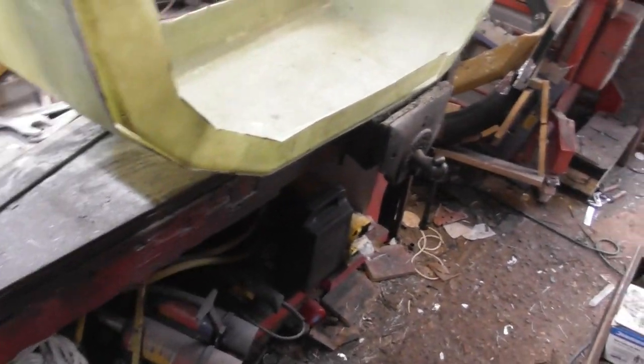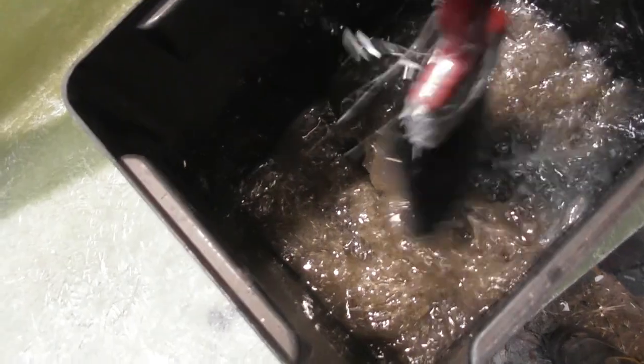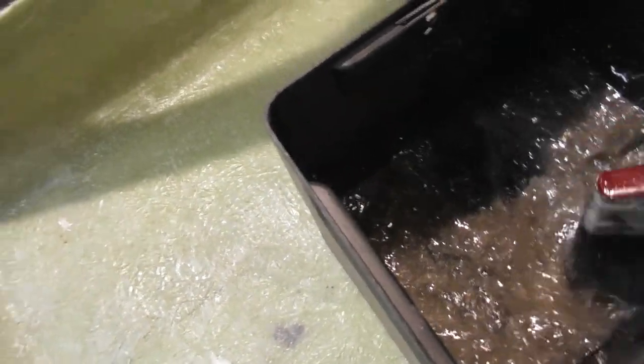Yeah, anyway, I've got to fill it and I've got to clamp it. Resin with a load of that. There was literally one handful I threw in there. What you do is you get your resin, you put your catalyst in first, mix that all up, wait till it turns the colour, and then you put this stuff in, one handful at a time depending on how much resin you've done. You can make this as thick as you want, but this will give you a bridging compound, which is also used as a glue in the industry for gluing parts together.